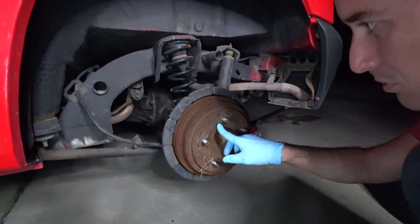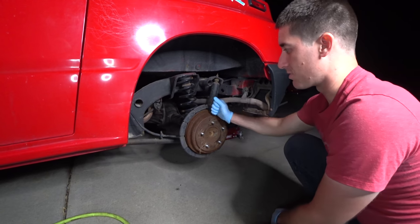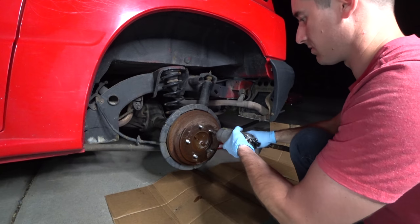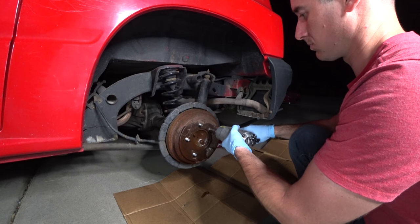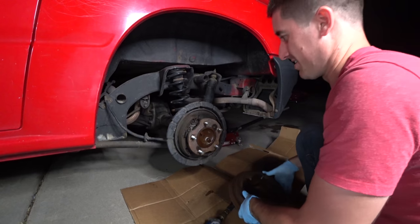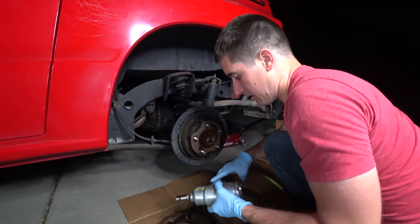These are M8 holes — you can put a bolt in there and use it to drive off the drum. But what we're going to do first is spray a little knocker loose around there, and that should loosen everything up. We'll smack it with a 2x4 — should come right off. We decided to go ahead and use the M8 bolt since I had one laying around. This one's a 13mm head and hopefully this impact pops it right off. I think it's completely off at this point. There we go — that was tight. And those shoes are toast. It's a disaster in there.